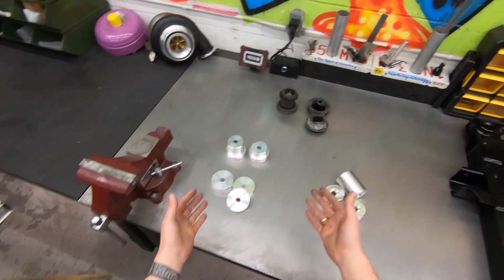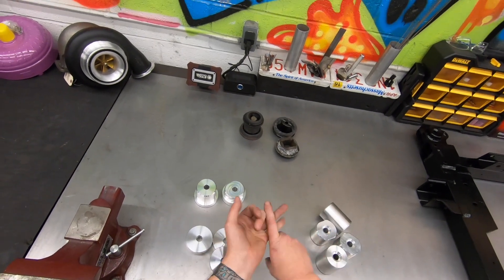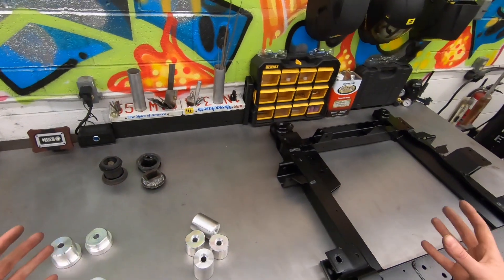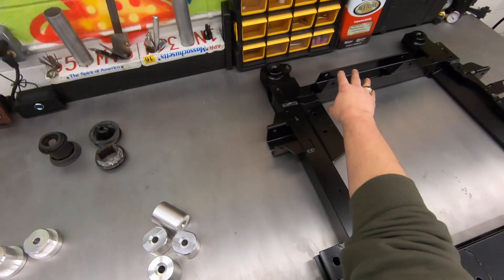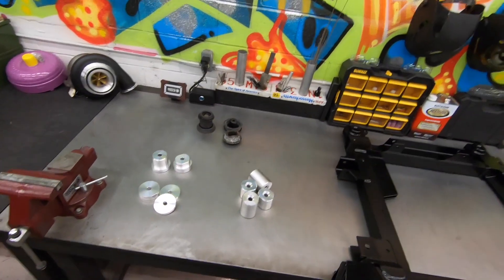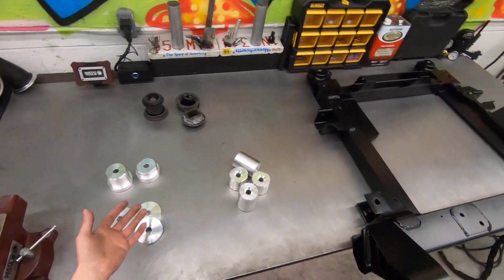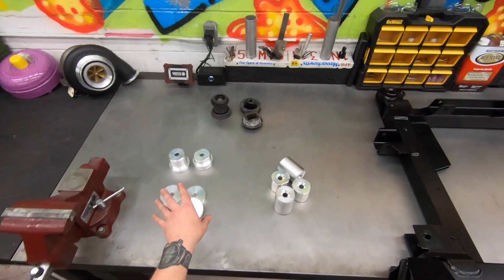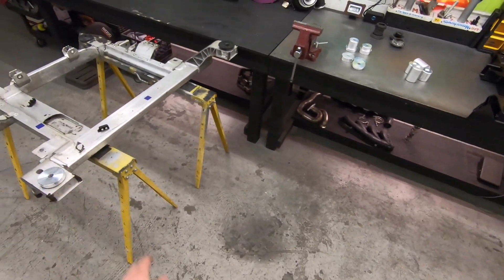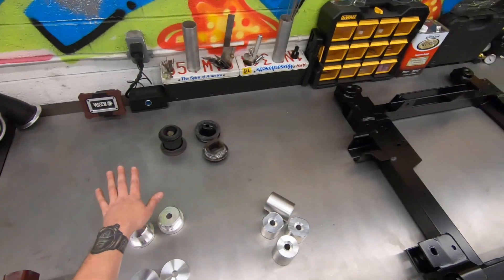Regardless of which style you go with, you're going to get increased hood clearance if positioned correctly, you're going to tie the subframe into the rest of the chassis, reducing another area of movement, and you're getting a lot more feedback in the cabin — you can really feel what the steering's doing, feel the control arms, more positive feedback from the road or track. These are definitely a really good investment. I haven't seen anybody else offering these for the W-body community unless it was a dedicated race car application with a tubular cross member.